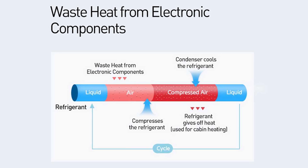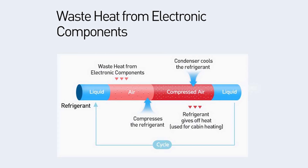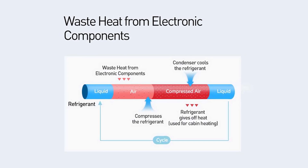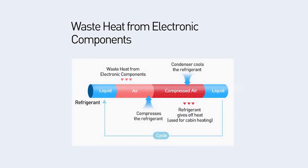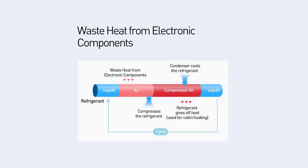So what happens when a heat pump is working? We'll get a little bit technical — a mini deep dive. The refrigerant absorbs heat from a source, like a warm battery for example. It changes from a liquid to a gas. That gas then gets compressed, which in turn heats it even more. This heat is then transferred into the cabin of your vehicle if you ask it to heat you up. And as the heat is transferred into the cabin, it cools down and condenses back into a liquid in a secondary heat exchange. Once enough heat is extracted, the liquid passes through an expansion valve to relieve the pressure. From there, it goes back through the same process again.